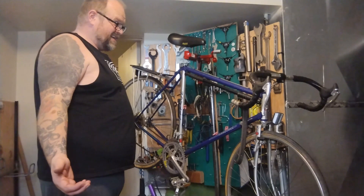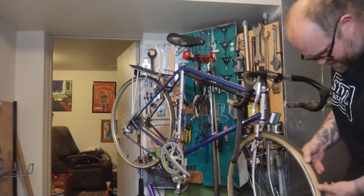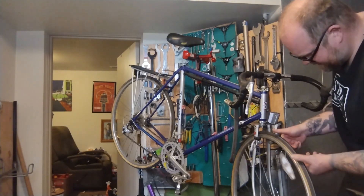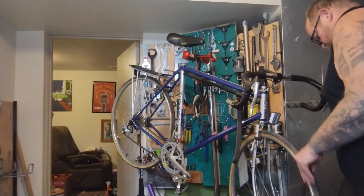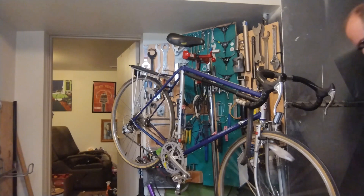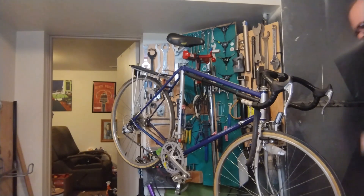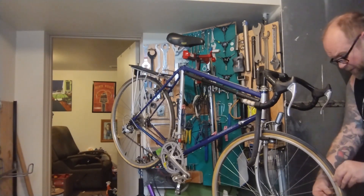I guess we should start with seeing if the tires hold air and see if the chain will lube up and get smooth. Tires are on the rim all the way around. The tubes are up inside the tire - not going to get pinched. I can see the little rubber rim liner and it appears to be intact. I don't see any giant gashes in the sidewall - there's a very good chance this tire will not pop and explode. It's 27 and a quarter. I probably want to go about 65 PSI because I don't even know if these rims are hooked-bead. These tires don't even look bad - they look brand new.